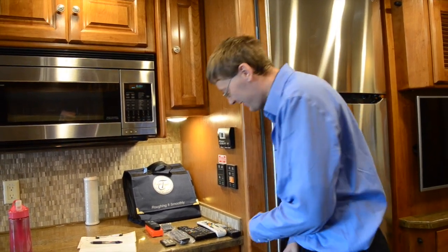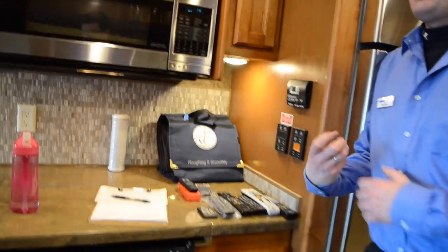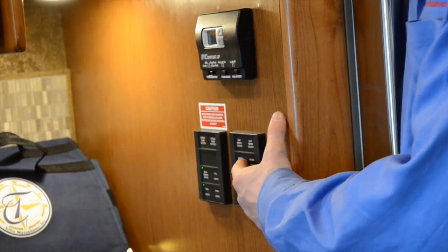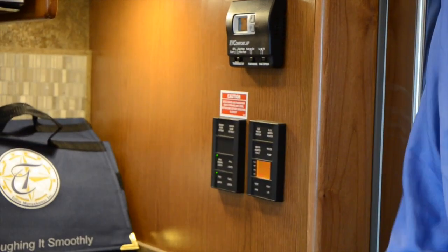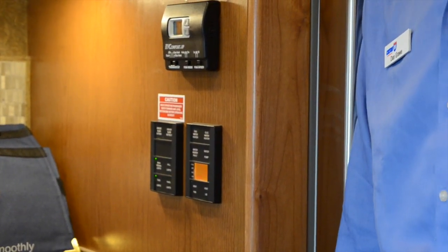Yes, you do. Water heater fault. That's gonna light up, letting you know that the pilot was not able to light for some reason. Whether it's an air pocket in the system, spider made a nest in there, whatever the case may be, that's going to let you know that the pilot is not lit. 90% of the time, air pocket in the system. If you can light your front or your cooktop, everything else in here will be able to light. Okay?